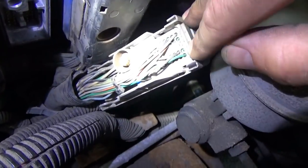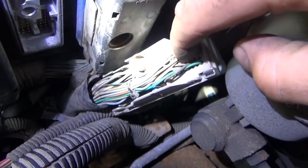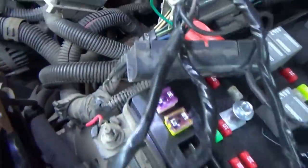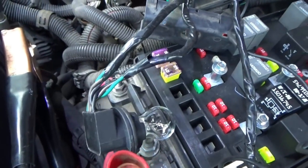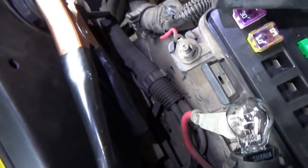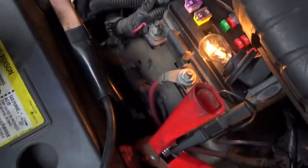The pins go — there's 40, 46, 56, 64, 65, 66. There is a black wire right there. Take our test light — it's going to be the third pin over. Our test light works. Check the pin. No light. What the heck? Let me double check that the pins are right. I was checking the wrong pin. It's actually 65, and 65 is that lonely pin in the middle — that's our main computer ground. Test light — our ground is good.